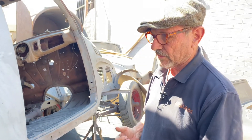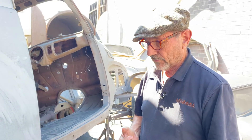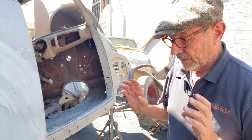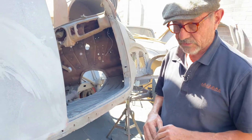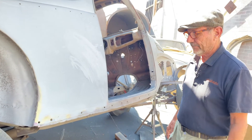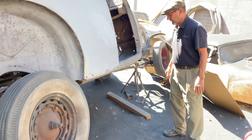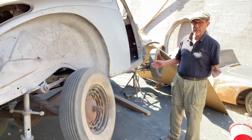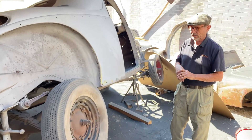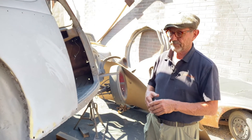That's the way we want the whole thing so that when we prime it, it has something to hang on to for permanent protection. We use red oxide on the bottom. You can also use a John Deere tractor product made for this express purpose — I think they call it Black Blitz — it's an excellent, very inexpensive product, only about 30 bucks a gallon for the whole bottom of the car. John Deere has been selling it for around 50 years. It's a one-shot deal — no mixing, no sophisticated spray gun needed.